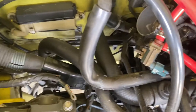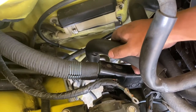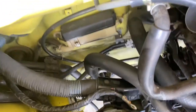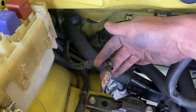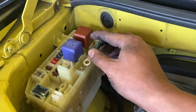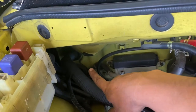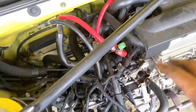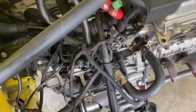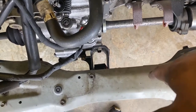As far as lines, we have a coolant line right here. This one has to get disconnected. This one also right here, but I'm not gonna do that right now because I always leave the coolant for last. And this is the starter that goes right here. What the hell? And then when Mark disconnects that ECU from over there, we're able to pull all this wire harness, leave all these connectors and wires connected. And as far as over here, that's all we have, a motor mount right there. This one we might not have to take off because we're taking off the cross member.